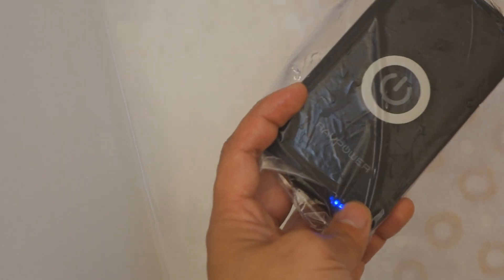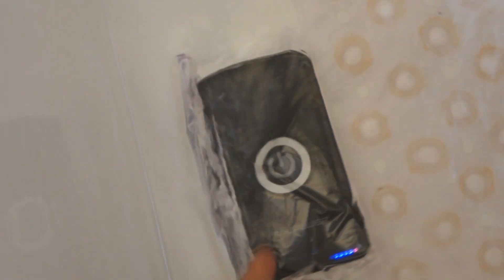That will actually turn green even if the wireless receiver pad is out of the device and just placed up against it. So what told us that it was working is the audio feedback in the Galaxy S5. Normally the screen would light up but you obviously can't see that because it's pretty much dead.